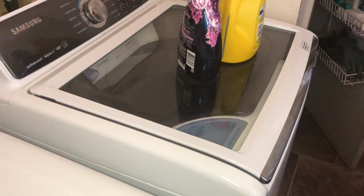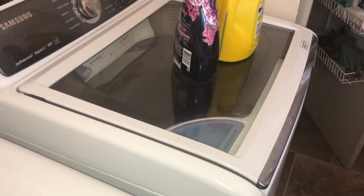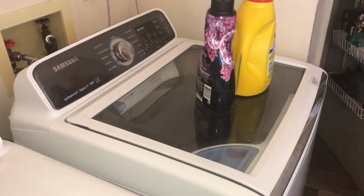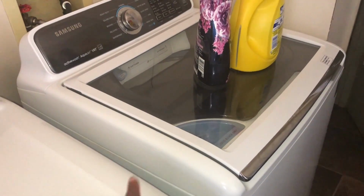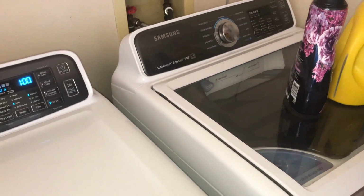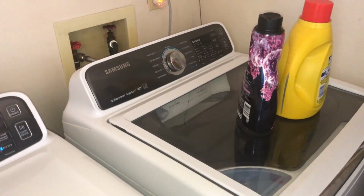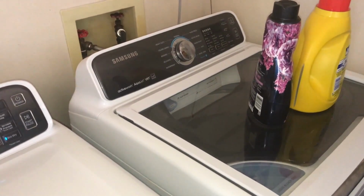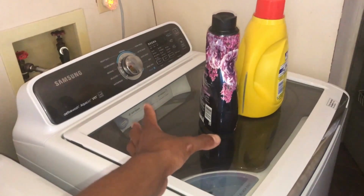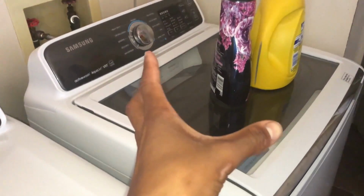And if that thing starts spinning and it gets off balance and you've got 13 to 20 towels in there, a full load of towels, basically, that thing's going to blow its top off. I have seen pictures of both LG and Samsung washers doing that, because people are not using the correct cycle for these machines. It's not so much a creature comfort, the reason they give you these cycles. They're giving you these cycles because they were programmed to operate for the weight and the size of those loads. They were programmed for those types of clothes. So you don't need to be putting towels in there on a heavy duty washer or a normal washer or a permanent press wash, because those are not the correct cycles for those bulky items.